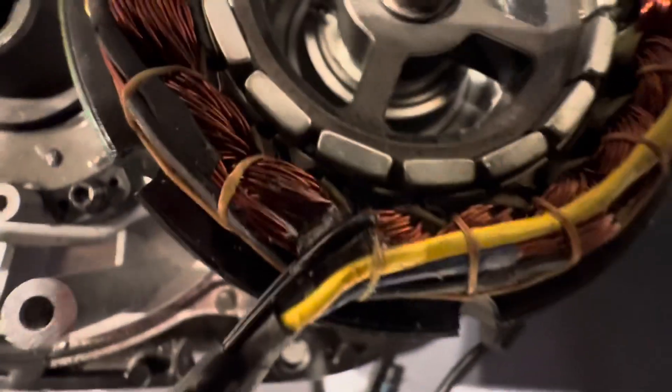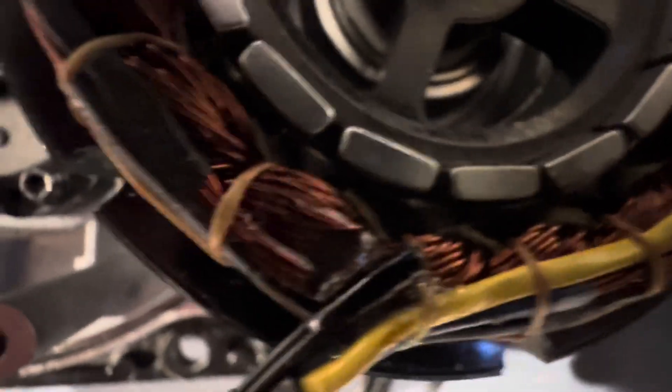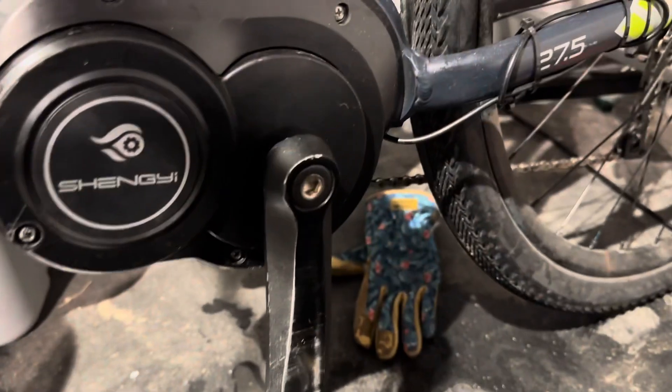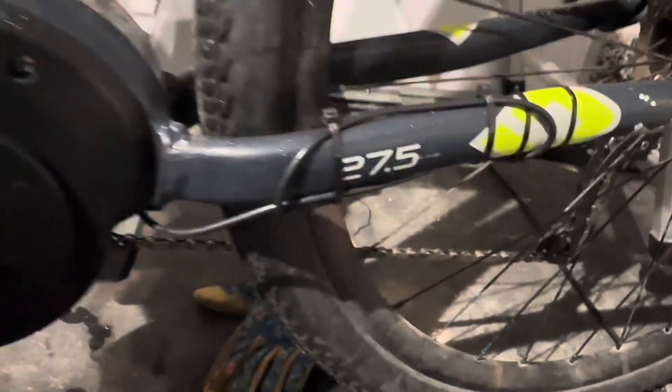To enhance the capabilities of this motor, I have epoxied a thermistor onto the motor stator. This will allow me to monitor the temperature and perhaps push more power through it. I had to replace the wheel speed sensor with one off AliExpress — it runs off 5 volts and works perfectly now. With the appropriate wheel circumference entered, it reports accurately.